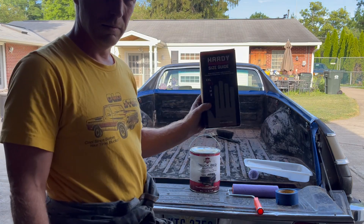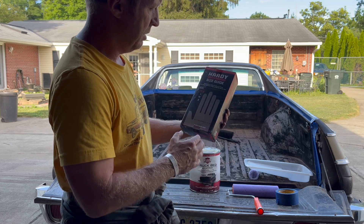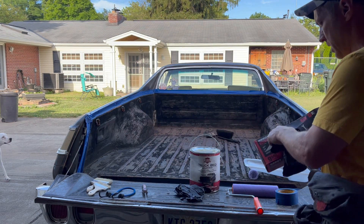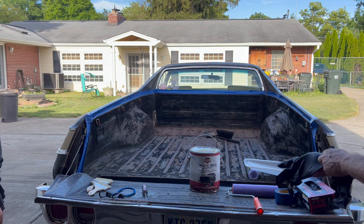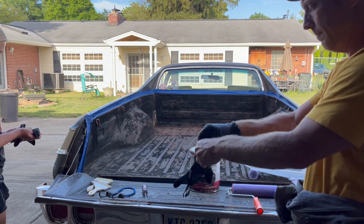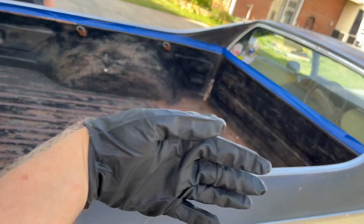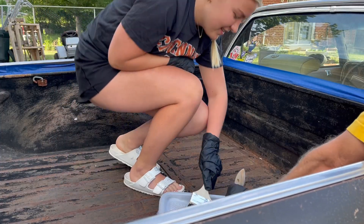I highly recommend gloves for this job. Place hand here. We're opening it the regular way. Set the gloves for you, set the gloves for me. If you want to brush it out, you can, but I got 99% of it out, and the rest of it's gonna be coated by a bed liner. A couple pine needles, a little bit of rust — it'll be fine. I think the best plan is to start with the brush, get all the corners and everything on this end, and work our way back with the brush. Then we'll get the roller out and do the flat part. We're getting all the corners with this stuff.